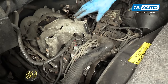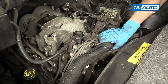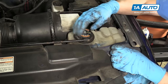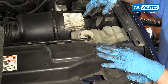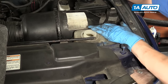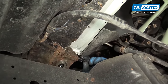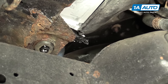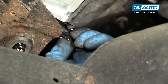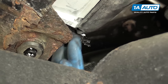This intake manifold has antifreeze going through it, so we're going to have to disconnect this upper radiator hose to get the manifold off. That means we need to drain the antifreeze out of the engine and the radiator. Right here on the driver's side front of the truck is your radiator overflow bottle — open this up to allow the antifreeze to drain much more quickly. Right here on the passenger side bottom of the radiator, you'll find the valve to drain all the fluid out. This turns counter-clockwise. As soon as it's done draining, you can tighten it back up and continue with the job.